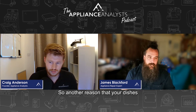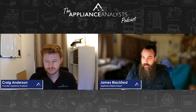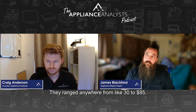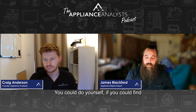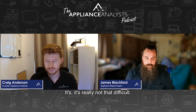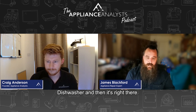Yeah, exactly. Another reason that your dishes aren't getting clean is your soap dispenser may not be opening at all. And typically soap dispensers range anywhere from like $30 to $85. And most of the time, that is a repair you could do yourself if you could find a video on how to do it on your model. It's really not that difficult. You essentially just have to remove the inner or the outer door panel, depending on the dishwasher. And then it's right there.